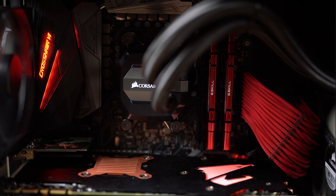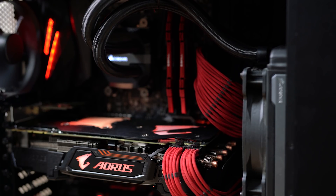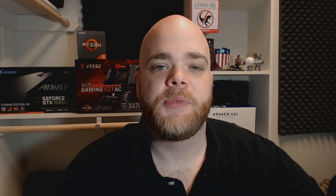For today's test we are using the exact same build for both tests, the only variant being the actual motherboard: the Crosshair Hero 6 for the x370 platform, and the x470 Gaming M7 from MSI. For the rest of the build we are using a GTX 1080 Ti with 16 gigabytes of DDR4 RAM. On the x370 board we're running that at 2133 MHz — the most we could get without crashing — and on the x470 board we're running at 3600 MHz, which is the main benefit of the x470 platform, with support all the way up to 4000 MHz.